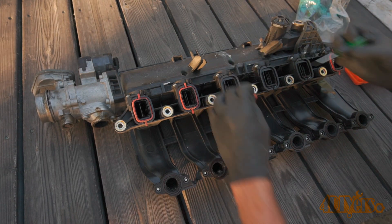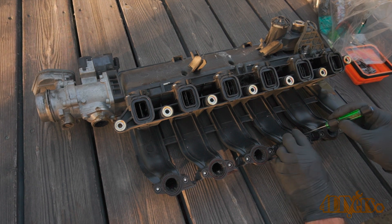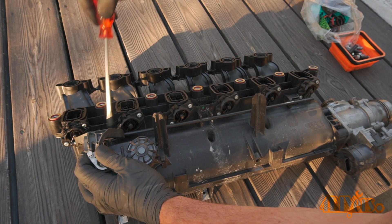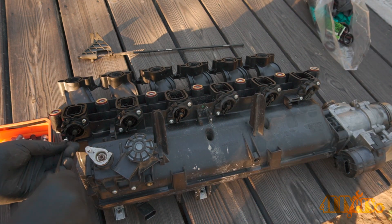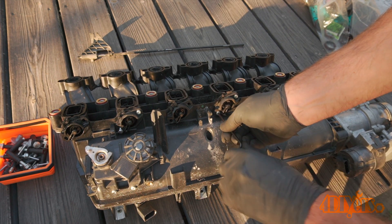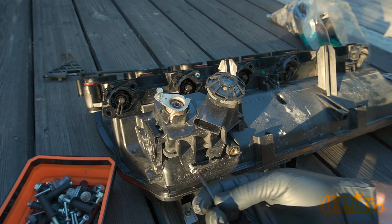The old gaskets were removed using a standard screwdriver. This intake was soaked in a homemade hot bath setup to remove carbon buildup, which is a common issue on these engines — I do have a separate video on that process. Using a large standard screwdriver, unclip the actuator bar for the swirl flaps, then pull off the main lever from the actuator motor. To remove each of the swirl flaps, a Torx T20 driver is required. The T20 is also required to remove the actuator motor for the swirl flaps, which must be removed to access the two Torx screws on one of the swirl flaps.